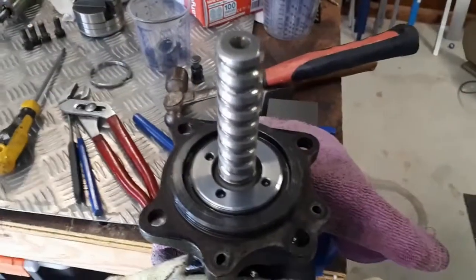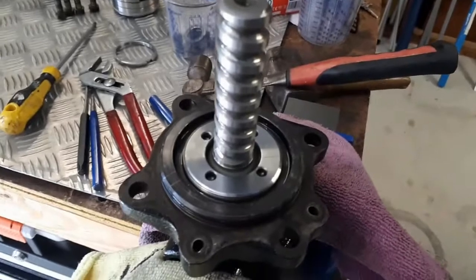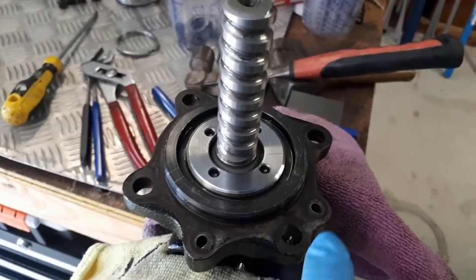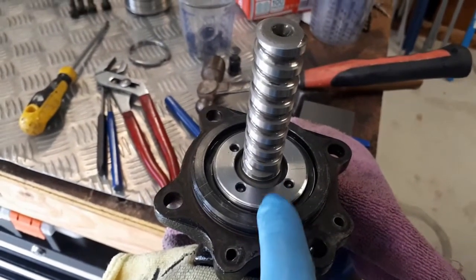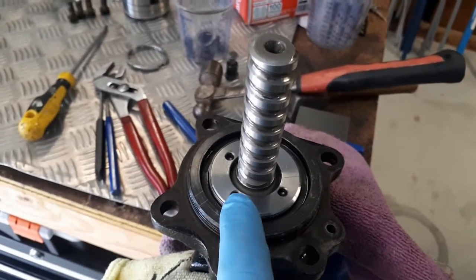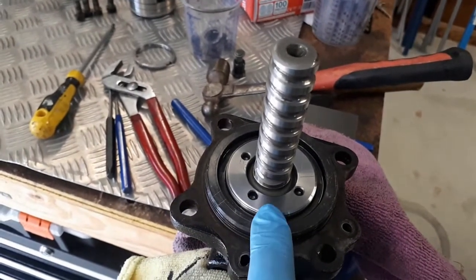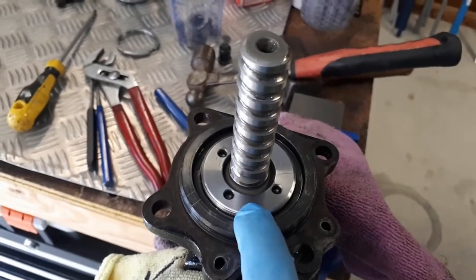Okay, righto, piston off. When I did the seal kit last week, which I did because the input seal was leaking as usual, I forgot to scribe this. So this is the preload. You can see a couple of marks here. They were actually from pliers undoing this ring, so they weren't actually scribed. So when I put it back together, I had no idea where I was.